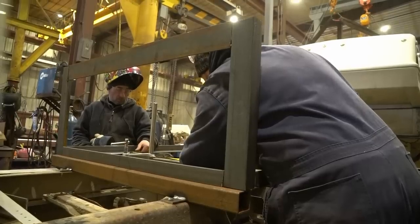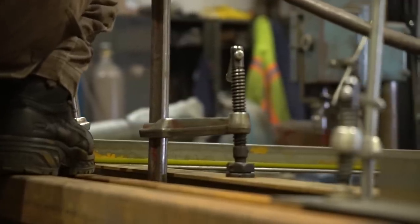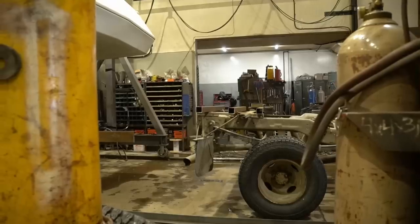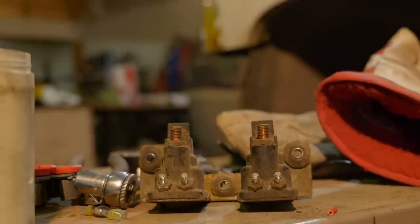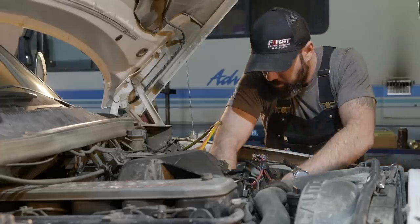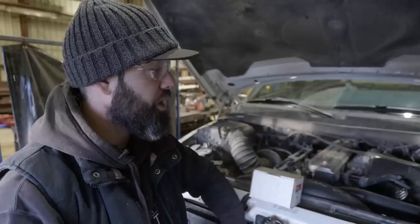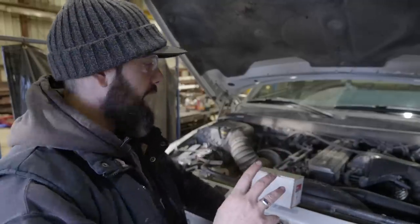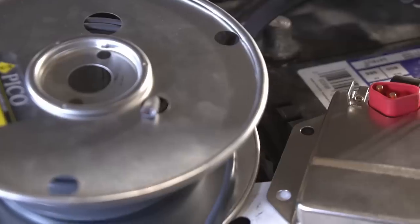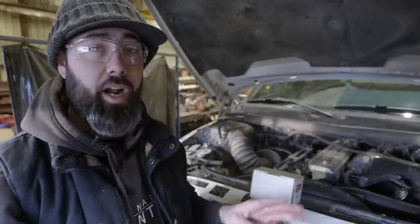By the time I arrived with the truck, the company had an entire game plan and were ready to get to work. I'm saving the back brakes investigation for a later date, but there are some important truck things I can tackle. You guys remember back in episode one where we were having some problems with the grid heaters — I replaced the solenoids but that turned out not to be the issue. It seems like we're having a PCM issue, which is a pretty common thing for this truck. PCMs are incredibly difficult to find. The great thing is you don't actually need the PCM, especially since it's standard transmission, so we're going to do a couple of bypasses: put the grid heater onto a push button in the cab and put an external charge controller on since I've been having some charging issues.